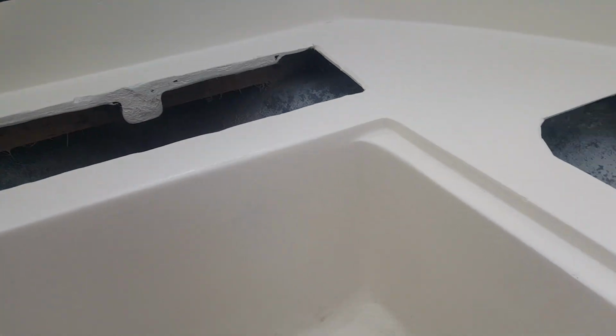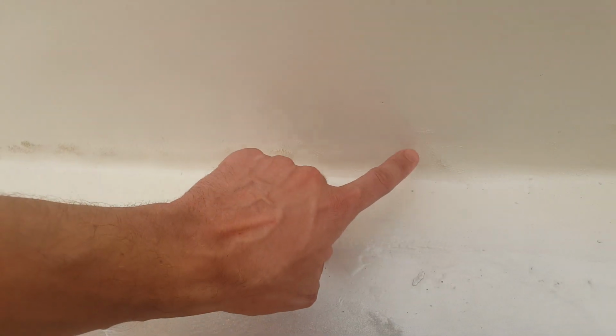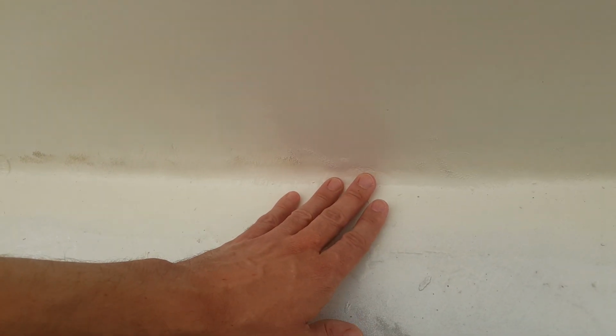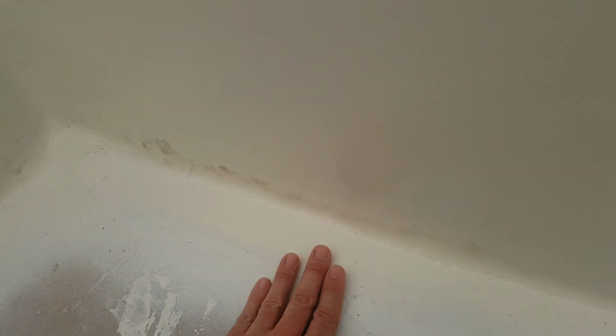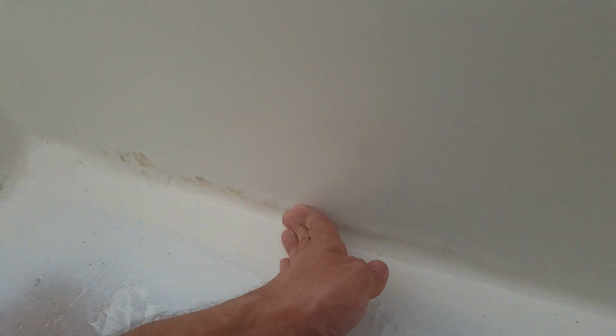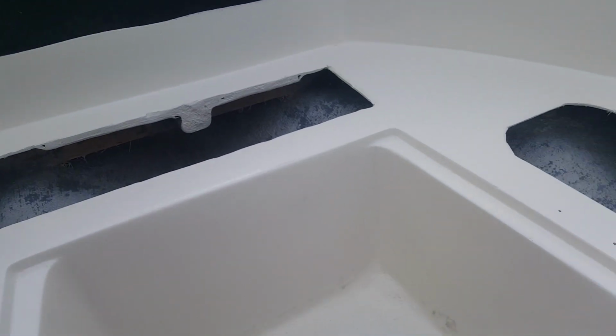So just to recap here, when you go to tie in the bow here with the flooring, consider using 1708. And it's good to have the Kevlar in the back side around there, but for this area, definitely do 1708. It'll come out cleaner. It'll be a nice look. But I tell you what, this is definitely stronger and more flexible than the 1708 would be.